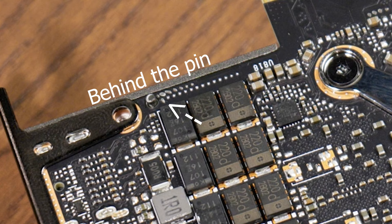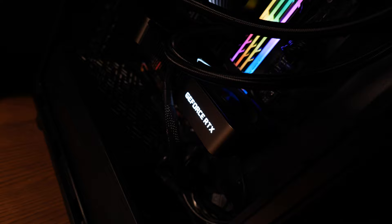Of course, this comes with the disclaimer that you may be voiding your warranty, and if you're not careful, you might damage the card. Even I didn't get away scot-free — the last time I was attaching the board to the cooler, it wouldn't fit for whatever reason, and I ended up breaking a tiny part of the PCB. It still works, but it could have been much worse. After applying the pads on the face of the card and reassembling, the fans ramped up to 100%, making it sound like my PC was trying to take off — it turned out I hadn't tightened the screws enough. Stuff can go wrong. If you want cooler temps and marginally better performance without tinkering, there's a solution — that'll be for the next video.